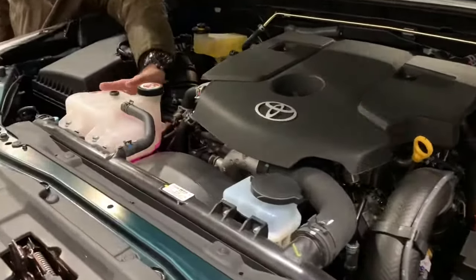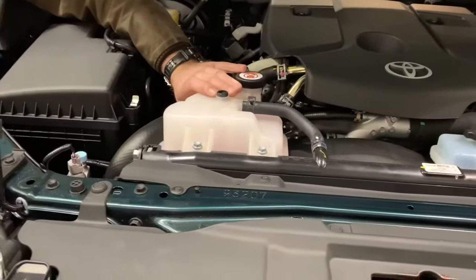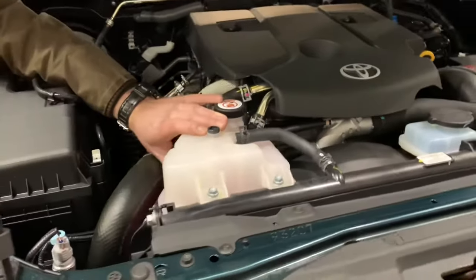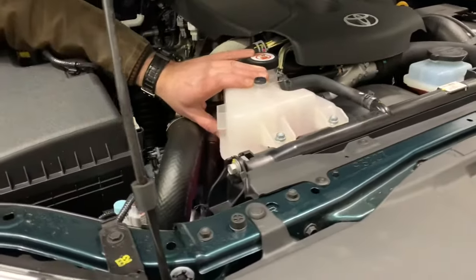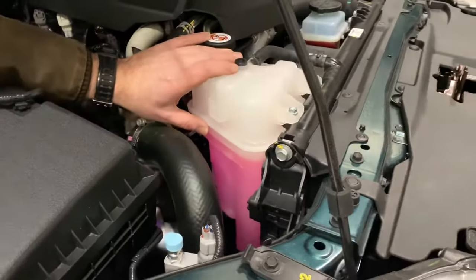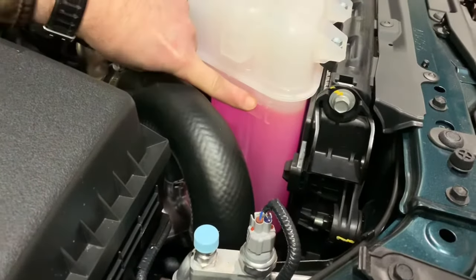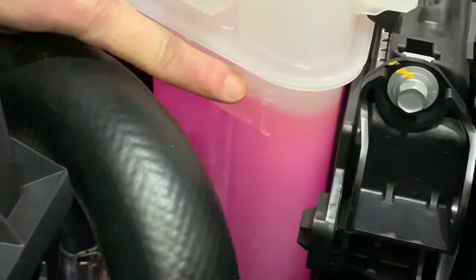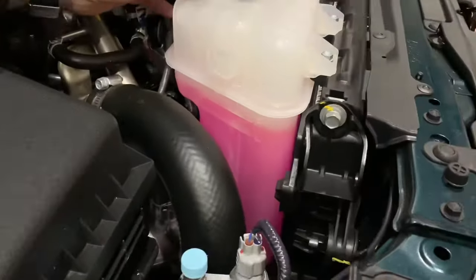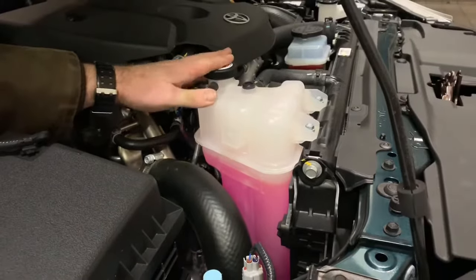On the side there's a level indicator I can show you, just so you know. It's important to keep an eye on these - a lot of people nowadays don't bother lifting the bonnet, but I think it's important to keep on top of it. Keep the coolant to where that level is when the vehicle's cold. It's also important that you don't undo the cap if the engine's hot - there's a sticker on there to warn you about that.